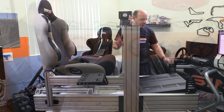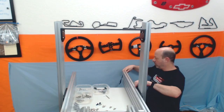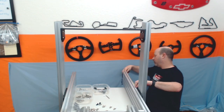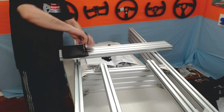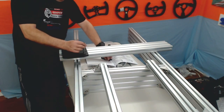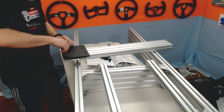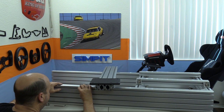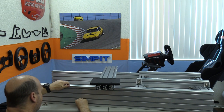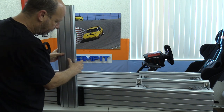I used a measuring tape to measure exactly where I was installing the first upright so I could match it with the second. We use two of the medium-sized double-wide profile pieces, and then the custom brackets. We use tapered bolts into the recessed holes to mount the bracket to the upright, then four more tapered bolts to hold that bracket into the side rails of the chassis.